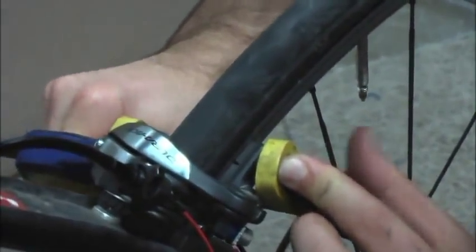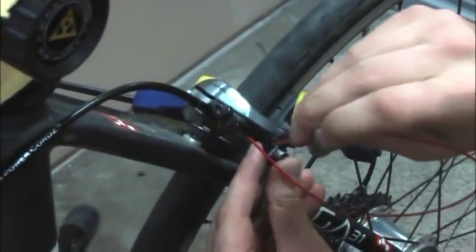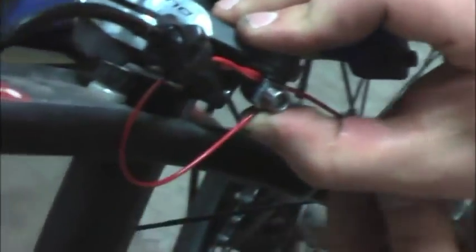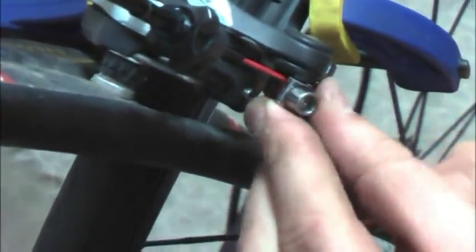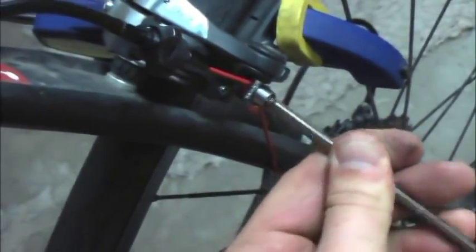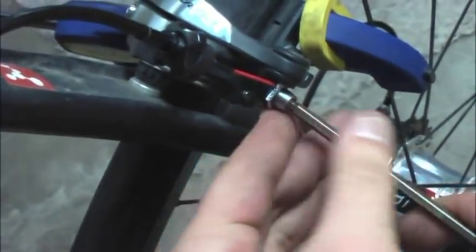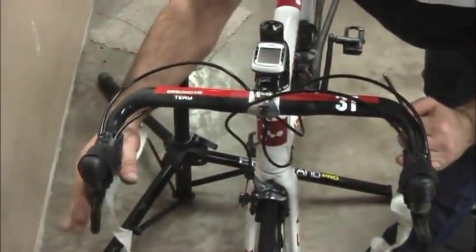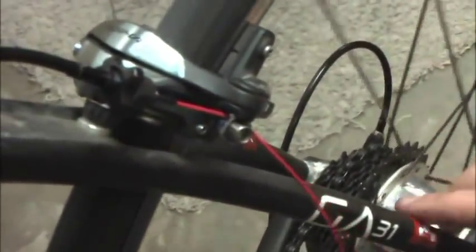Then, attach your clamp or third-hand tool to the rear brake. After fitting the grommet onto the anchor bolt, run the cord under the anchor bolt following the same entry path as the original cable. Then, wrap the cords 360 degrees around the anchor bolt while creating an overhand knot, as shown. Holding the underside of the knot in place, pull down with one swift motion to complete the knot. Tighten the anchor bolt in order to hold cords in place. Remove the third-hand tool or clamp and give the brake levers a squeeze to ensure ferrules and housing are properly seated. When you're satisfied, tighten the anchor bolt all the way and cut cord to the appropriate length.